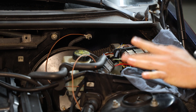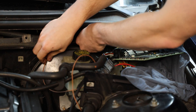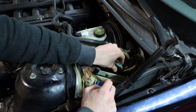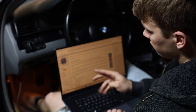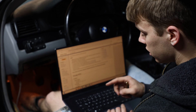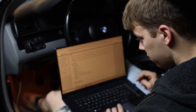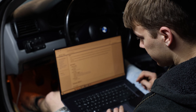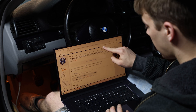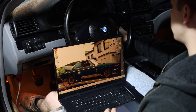I've already disconnected the battery — I'm just going to wait a few minutes for any residual charge to leave and then disconnect all the connectors. I'm now on the main page of the MS4X Wiki. I'm going to go to Firmware Files on the left and then choose our engine and ECU combination: MS43, E46, M52 TUB28 Euro 4, left-hand drive. This is it — it'll start downloading once I click on it. This is now a full 512-kilobyte file which we just downloaded, and now theoretically we should be able to write it.